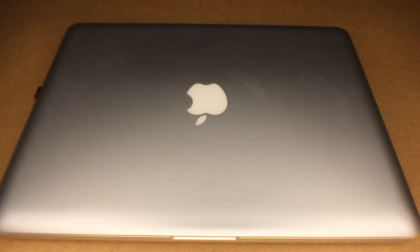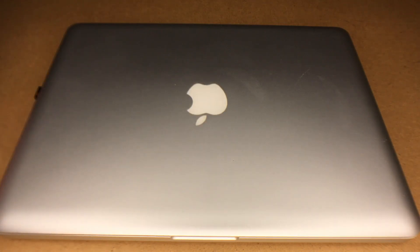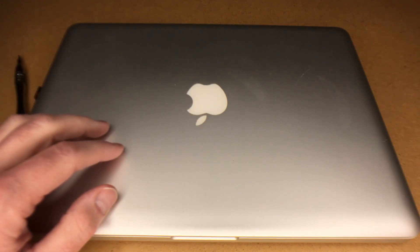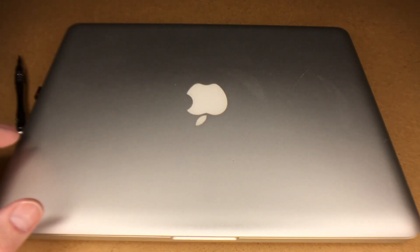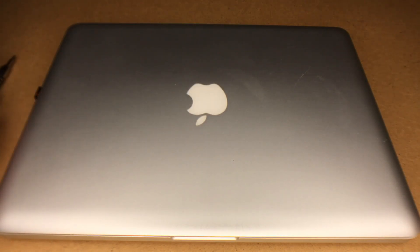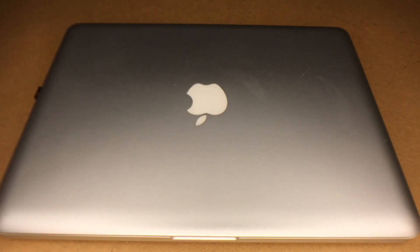Welcome. In this video I'm going to talk about replacing the SATA cable in this mid-2012 MacBook Pro. This has been having some weird glitchy issues, and I think it may be due to the cable being bad — they're kind of known to go bad on those. I'll be taking it apart and replacing the cable. If you're not comfortable going into a computer, this video may not be for you, and also make sure you have a backup because things can always go wrong. So I'll flip this over.